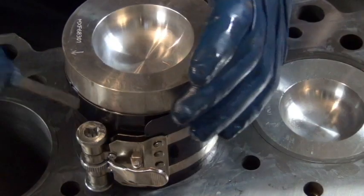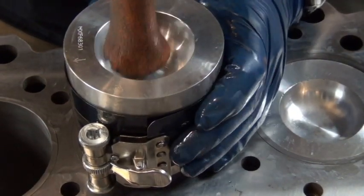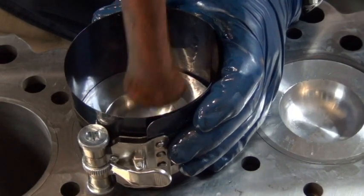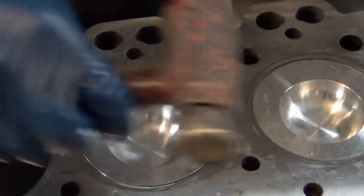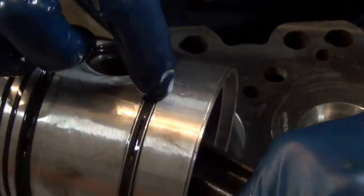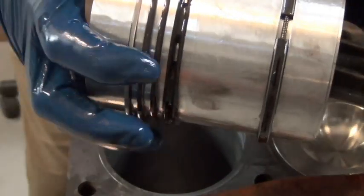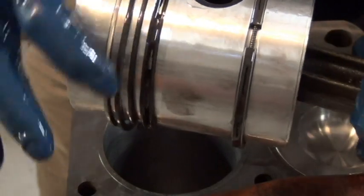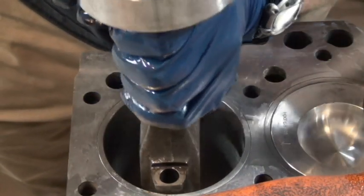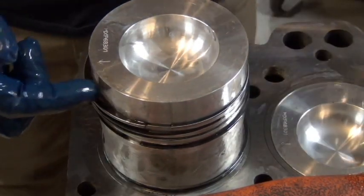Let's see if we can get this one to just go right in. When everything is compressed good, it's not a problem — unless you drop your key to the piston ring compressor. You just gently tap them in; it's usually really uneventful. The tighter you get it the first time, the more square, the easier it is. One trick: when you pour the oil on it, especially on the one with the little ring in the middle, pour the oil directly in that hole — it really helps it get all around. These actually expand and contract just a little bit on each stroke, so you want some oil so they can do that. Usually the rings don't wear out so much as the landings wear out — the little grooves in the piston. That's where the wear occurs on these diesels. There are gauges you can use to check if they're worn, and each brand has its own proprietary means of checking, especially on the top compression ring.